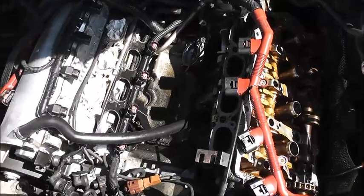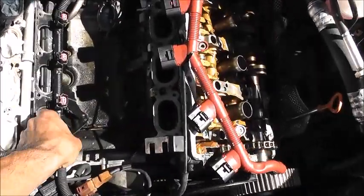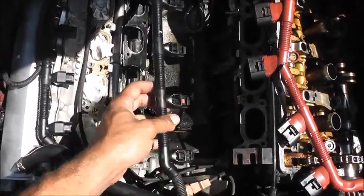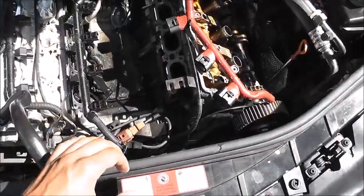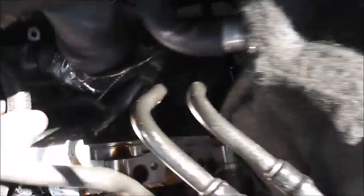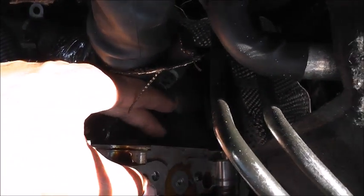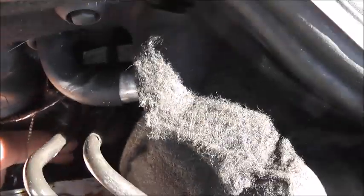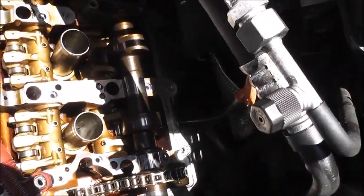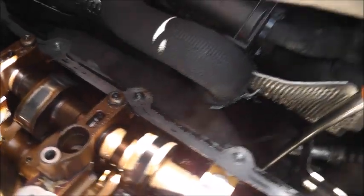So here right now you can see pretty much what I've done already. The main inlet manifold is off. Some injector cables there. The main bulk of the work is done. I removed all of the pipe there, and removed the bolts from that and the valve that sits on the back of the cylinder here, and also the exhaust bolts there. But with this head I can't get to the exhaust manifold bolts which are down there, so I'll leave this on and bring the whole thing up all at once.